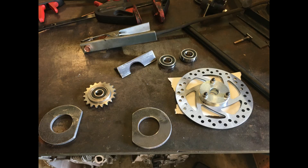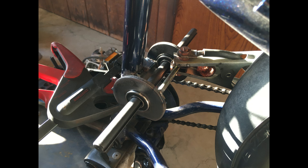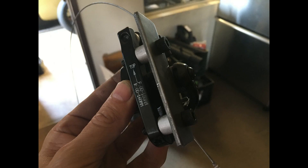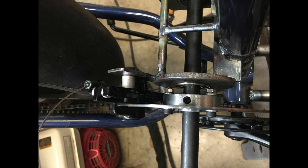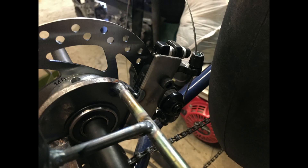The 79cc engine is sitting on a go-kart mount. This is the beginning of a jack shaft system — we have a little idler sprocket and a piece of angle notched for the seat tube with bearing hangers welded to it. We're using the factory Dolomite cable-operated brakes, moving the rear caliper to the jack shaft. We made a custom caliper bracket for the jack shaft brake, which is a strong and convenient rear brake solution we use on pretty much all our motorized bicycles.